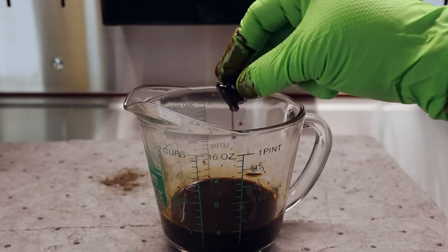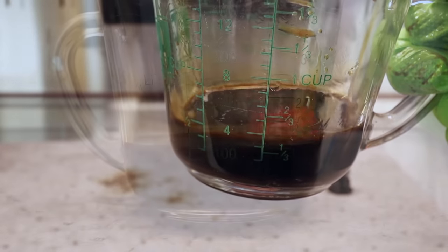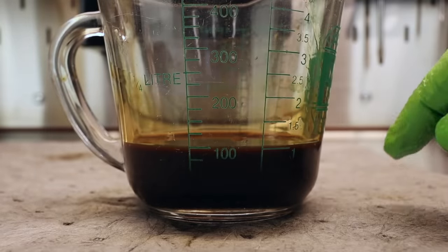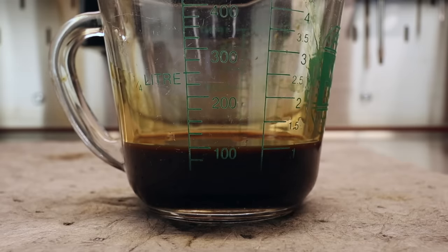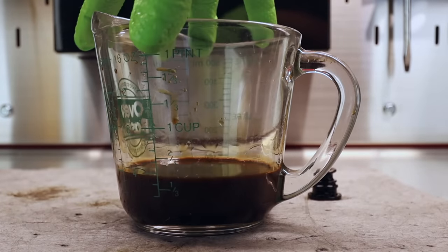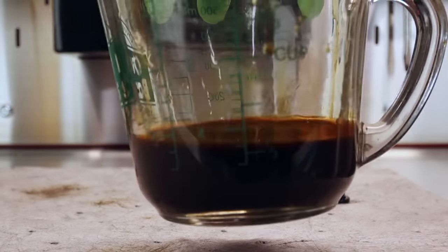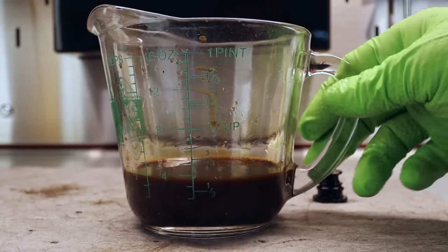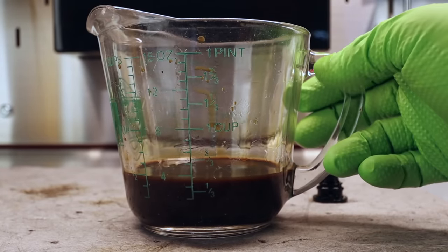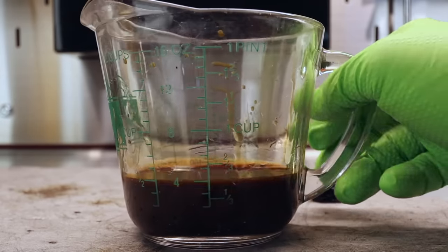Oh no, our readings are screwed. So that's less than a half a cup. Let's see, we got milliliters on it. Let's go ahead and call that right about 100 milliliters of oil that we left in the pan. Okay, so now the question is, are you comfortable leaving that behind? Is this the difference between taking the drain plug out with the engine hot versus the engine cold? Is this the difference between letting it drain for 10 minutes or letting it drain for 3 minutes?